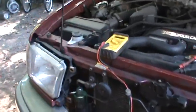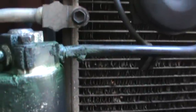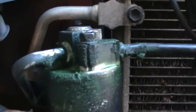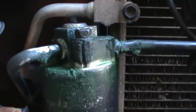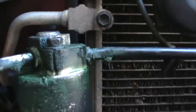And this truck, about once a year, I need the AC recharged, and that ought to be why, huh? Pull the grill out, you can see the green telltale sign that that O-ring's leaking. So probably next spring, before I put a can of fluid in it, because right now it's still working, I'll pop that out and change the O-rings right there.